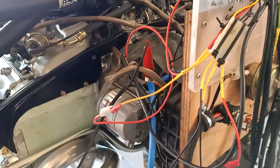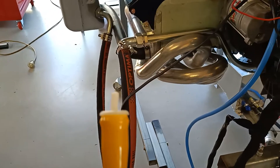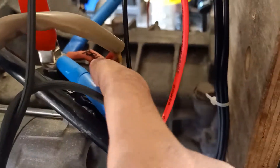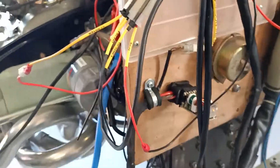To simulate a key I'm using a remote starter rather than a key switch. All it does is bridge between the positive terminal of the starter — you can see the red plastic boot — and the solenoid terminal. I've got an alligator clip on the solenoid terminal, and you can see the yellow wire connected there on the starter motor.